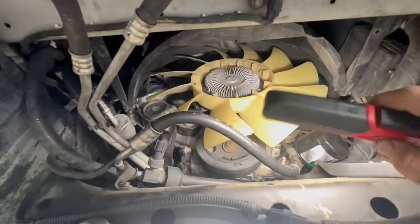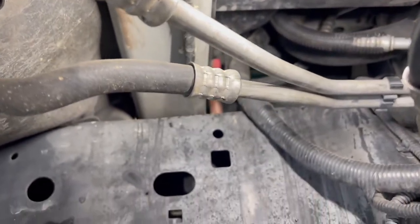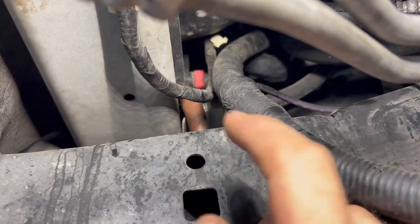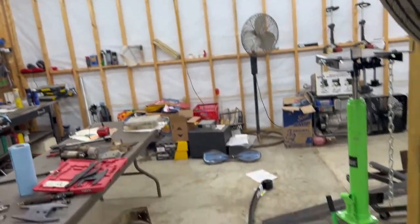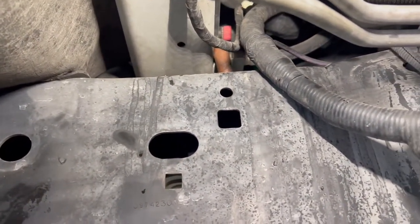So now we're going to show you the procedure for going through this whole thing and throwing a water pump on here, and it's actually pretty easy. The first thing we want to do to start this job is drain our coolant. If you see the red thumb screw up there, that's your drain. I have a hose on it coming down here. We're going to catch it in a clean pan and dispose of it properly. So we're going to drain our system and then we'll start pulling stuff apart.